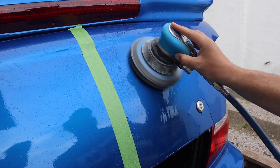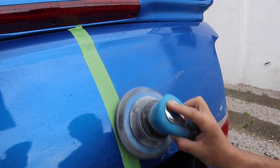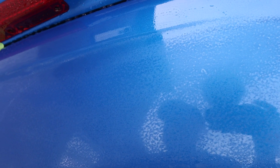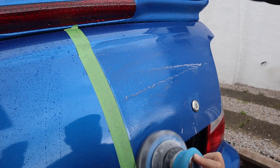My process is going to be starting off with 1500 grit sandpaper. I'll make a first pass, then wipe it off and see how I'm looking with the orange peel. After one pass, you can see there are still some shiny spots there - we want it to be looking really matte. We want it to be completely matte, which means the panel would be completely flat before we start going in to do any polishing. Moving on to the second pass, knowing that I've still got quite a lot of orange peel to knock down, I'll take a bit more time doing this before assessing it again.